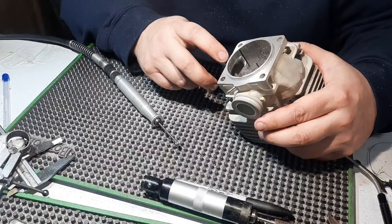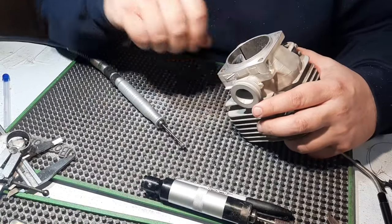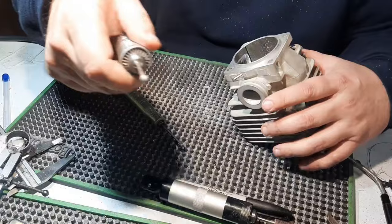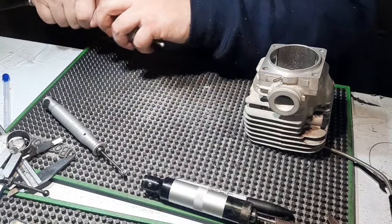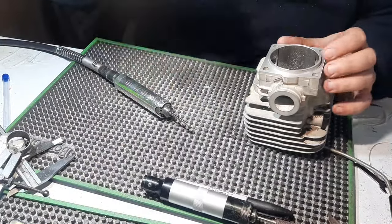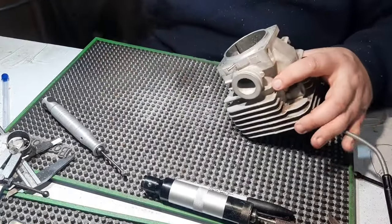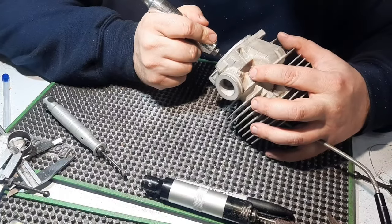Now anytime you're cutting on the climb side, you want to be very careful of your plating. It's actually a good idea to go in with a diamond to hit your line, go right through the plating, because any type of burr can get underneath the plating and chip it up. So to finish our line here, we'll go in with the diamond stone.